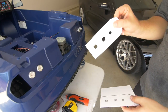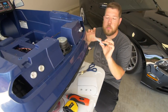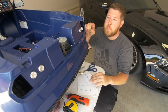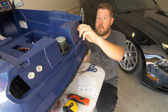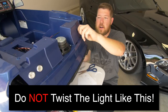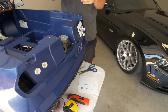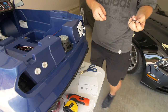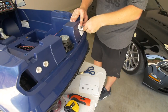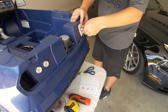We're gonna go ahead and get our tail light holder installed and we'll get our third tail light run. And just so I don't put too much stress on this little thin piece of plastic, I'm gonna go ahead and back these out the majority of the way where the wires are just showing so that it's easier on the plastic to slide it around. Now we have the tail light holder in place. Take one of our new tail lights and run it through the same route we did for our existing tail lights. So now we're just gonna reinstall the first two tail lights in place.